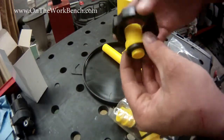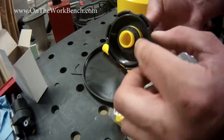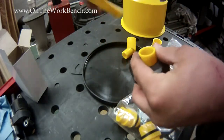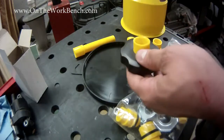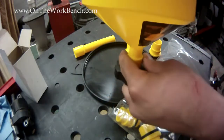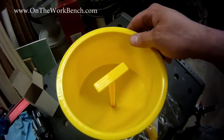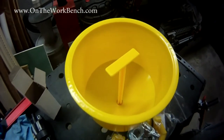Based on the cap selected, you find the right fitting — this one goes down into my radiator hole and screws down on the radiator cap. The washer helps keep a nice firm seal. Then you add the funnel or an extension depending on your vehicle type, and which cap adapter it requires. Put the funnel on top, and I've got my plunger in here holding it shut, ready to use whenever you remove the funnel to make sure nothing leaks. Now let's go to the vehicle and install it.